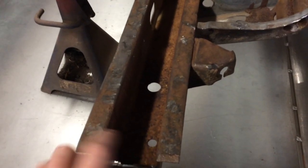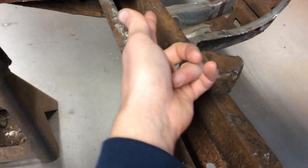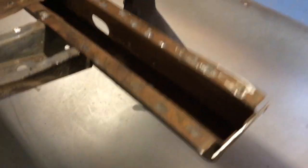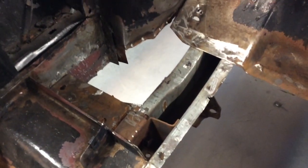The cross member is in good shape. The top of the floor supports — they want you to keep the top rails of the floor support on both sides. With that front suspension kit, I'll basically be cutting the whole floor support out for the most part. Up there they want you to join it differently, but from the transmission mount back, you're cutting it out and welding the new floor support in, butted up against that upper flap that's going to get mounted to the floor pan. The original floor supports are actually in really nice shape — no rust in them the whole way up, which is strange. I've got to clean up all that metal where the seat platforms and floor pan go, the whole way around, and prep all that metal for the new floor pan.